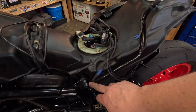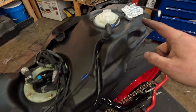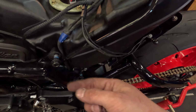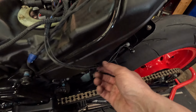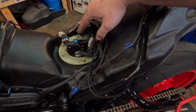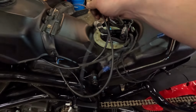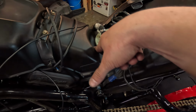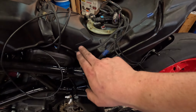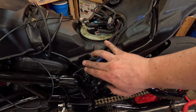All right. So what you want to do is route your fuel pump connector and your taillight connector up through this groove right here. Make it all nice and clean. Disregard this, this is my plate stuff. Put that back in, then I'm going to zip tie this all nice and neat up here. Should give me plenty of room to stick that access stuff up in here, because that seat sits kind of high. And then this is where I'm going to put the actual computer unit.